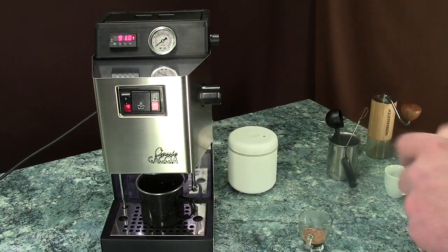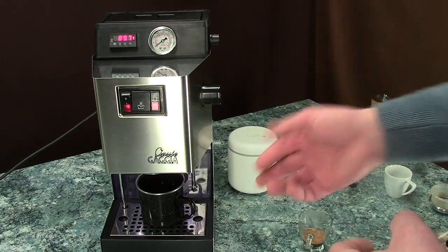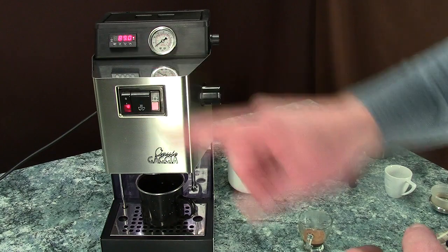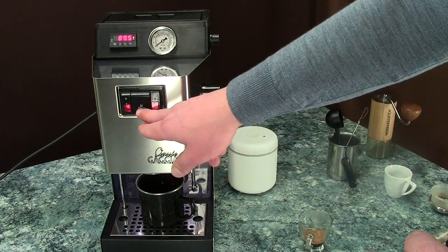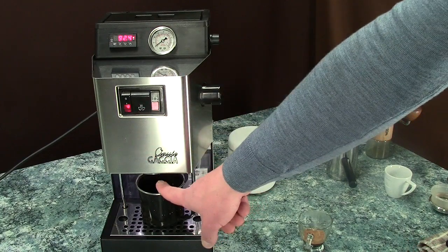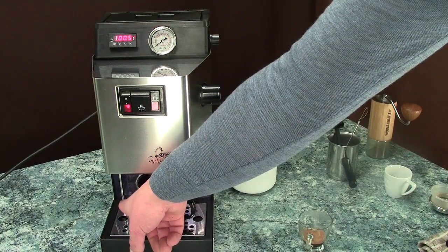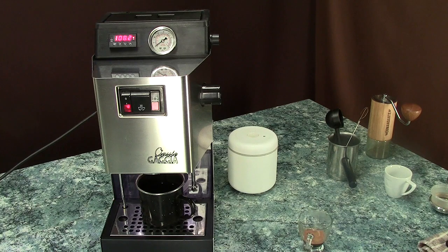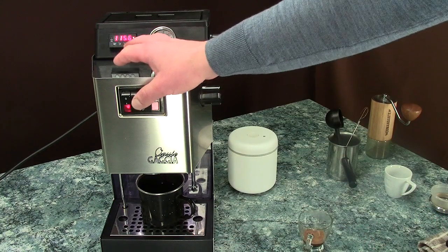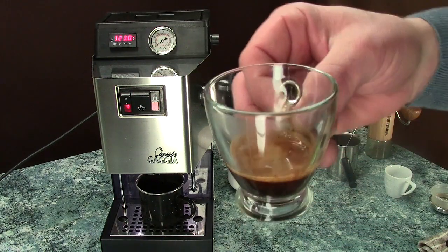So what you see in there, the Intrashot temp surfing, it is the ability you can turn to steam mode throughout the brew. You can't do it on a basic classic because once you hit the steam button, the solenoid valve is going to close, and whatever you had on top of the coffee puck is going to come through the outlet tube to the drip tray. So that's not handy because those are the senses of your coffee.